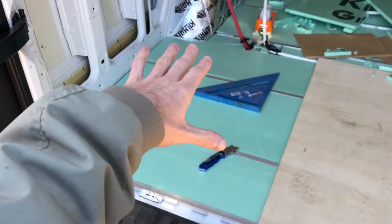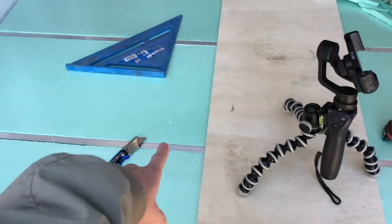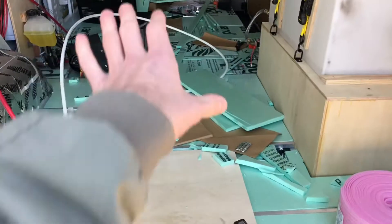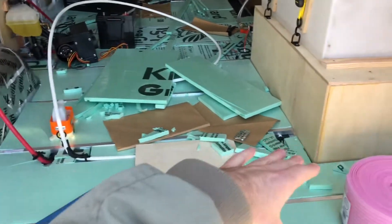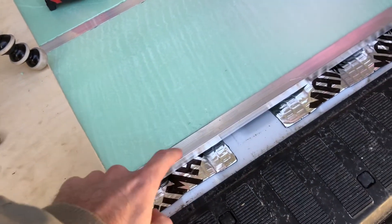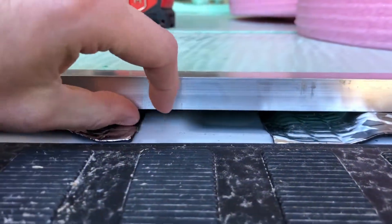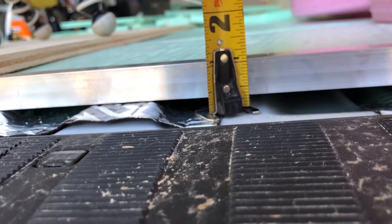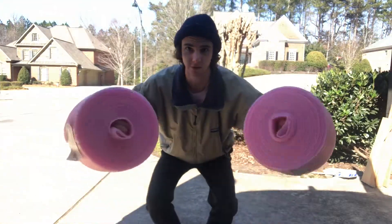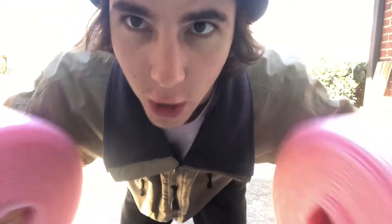All the way to the wheel well — this area — and I stuck my kill mat on the rest of the floor. With the 15 and a quarter inch spacing, I put the pads at 16-inch increments, so in some places the aluminum overlaps, and in the back I'm going to have to cut it so I can glue it to the floor. I see these little gaps — about five-sixteenths, quarter-ish — so I got these rolls that are a quarter inch thick and I'm going to cut little strips on a bandsaw and just lay them wherever I have those gaps. Simple, and some extra insulation.